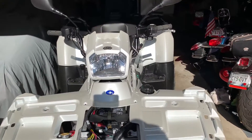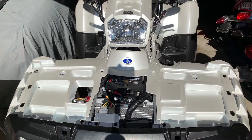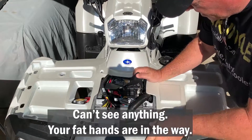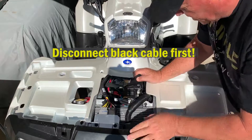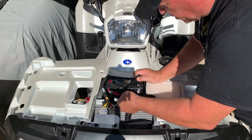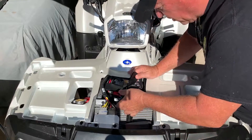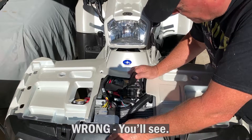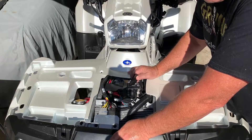Come a little closer on the battery. As you can see here, it's a bit congested. We're going to need to be opening some of this up. They always recommend disconnecting the black cables before you disconnect the red cables, so we're going to be doing that. During the installation, there are times when they want you to get to a couple of things in here. There's a harness in here we have to connect to. Here are some parts off the main harness — we'll be using that. Here is the battery tender; we're going to be disconnecting that and reconnecting it at the end. So let's begin.